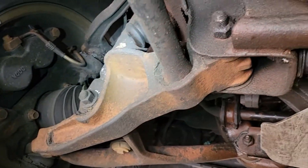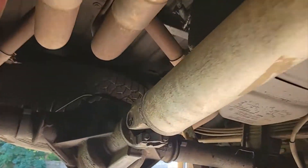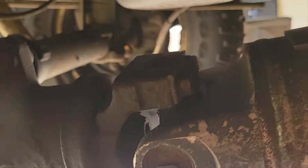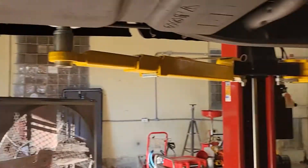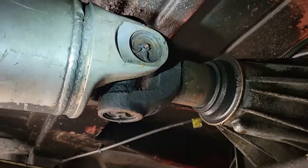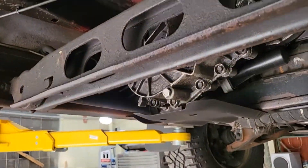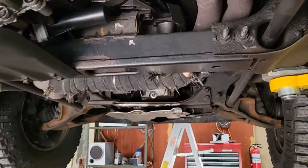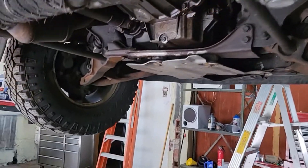You've got a bunch of points to grease and I'll show you how to do those most efficiently. Now because I have aftermarket u-joints, I also have bleeders on my drive shaft on the u-joints there, and I got one up here. Those are the needle style. Most of these trucks are similar and people at this point have some replacement parts, so the drive shaft ones are useful to know.